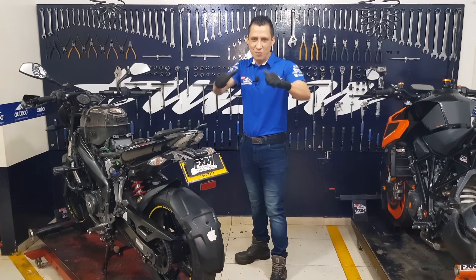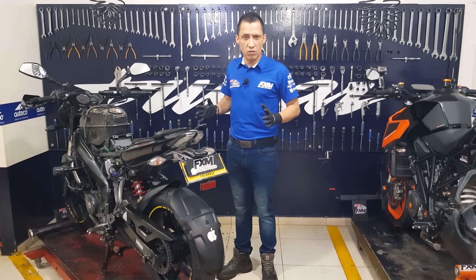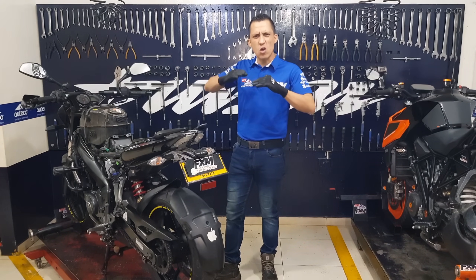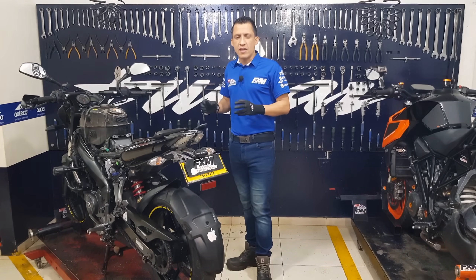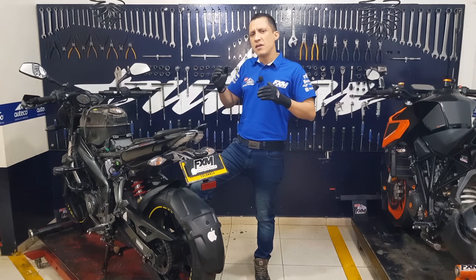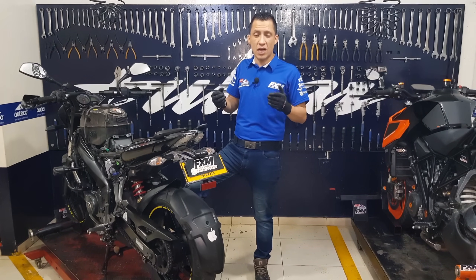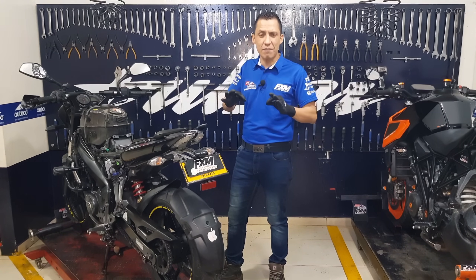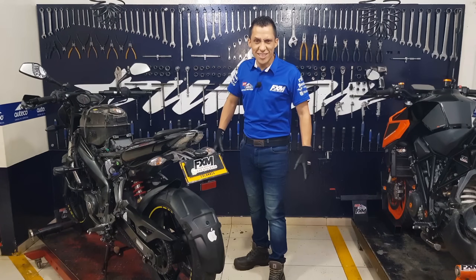What's up, FixerMotos friends! My name is Cristian Pirateque and today we're going to perform a corrective maintenance, since this motorcycle has an excessive sound in the cylinder head — a quite strong knock in the upper part, which is in the cylinder head. We already did the verification with the stethoscope and the sound is indeed abnormal, very similar to when the valves are open, that is, out of adjustment. But we already did the calibration and the sound persists. Stay with me until the end of the video, because we're going to repair this Pulsar 200 NS. Let's go!